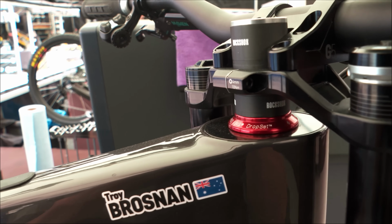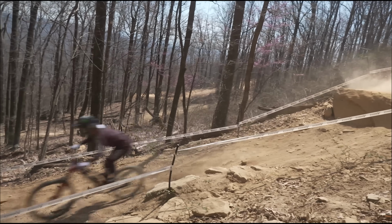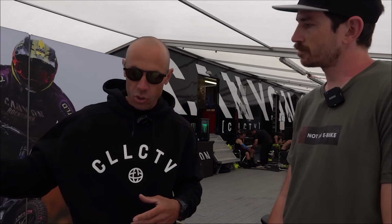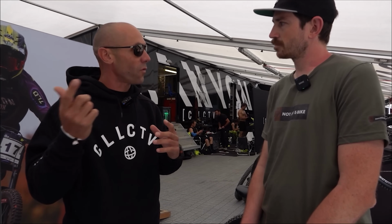So how would rider position and braking points be different on a bike with higher anti-rise versus a bike with really low anti-rise? Well, you just have to look at the dynamic sag. Basically, under a braking phase, if you put the data acquisition on a bike with very low anti-rise, you will quickly identify that you will be higher in the travel and create more traction, but you also have the same effect on the front, which will increase the fork diving and the issue of transferring the mass onto the front and destabilizing the rider. So my whole point, and again, it's the whole story behind this chassis, is to put the center of gravity of the athlete in the best position in every phase, so the riding capacity and abilities of the athlete are enhanced a lot more than the pure functioning of the suspension itself.